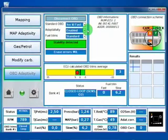Okay. Now the adaptivity is enabled, and the fuel trims are standard because they are normal fuel trims. So normal fuel trims are, for example, what you see on petrol, that are leading to 0. This is a little bit far from 0, but it is not a problem, it's good. This is not a new car or a perfect car, it's a testing car, so maybe the fuel trims are not always at 0 as they should be.